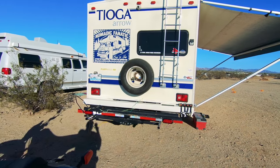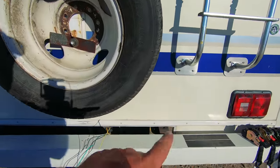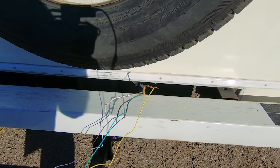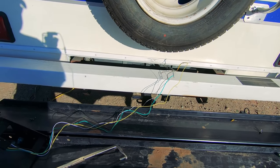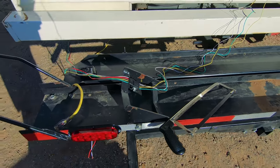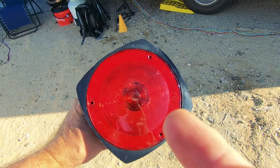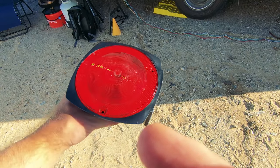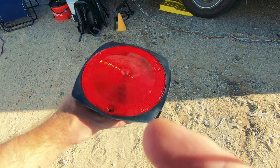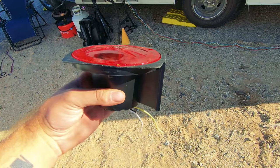The first part was tapping into the lights right here — I've got yellow, green, brown, and white available. I picked up a kit which didn't work, so I built a little four-pin flat adapter. I'll show you: these are the cheap $15 lights I got. They have incandescent bulbs, the running lights don't work at all, and the brake lights were swapped with the turn signals, so the turn signals were brighter than the brake lights. It was probably a bad purchase.